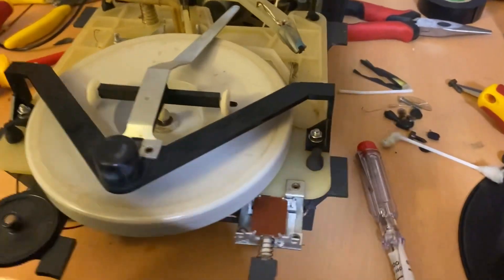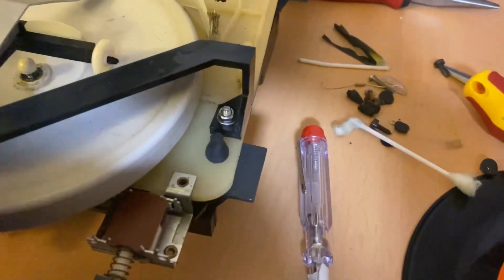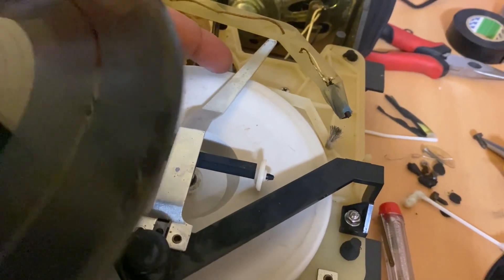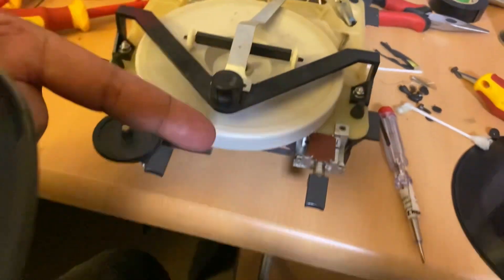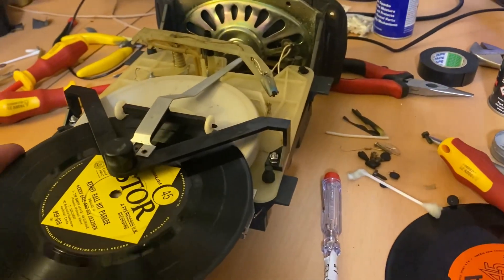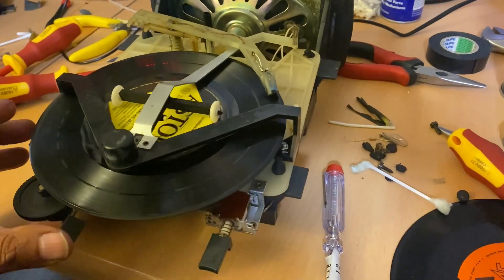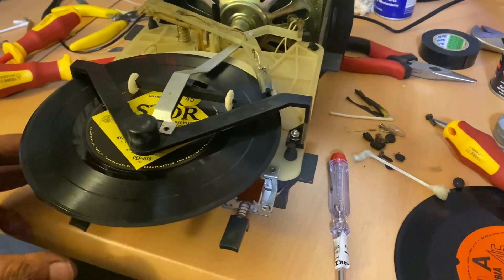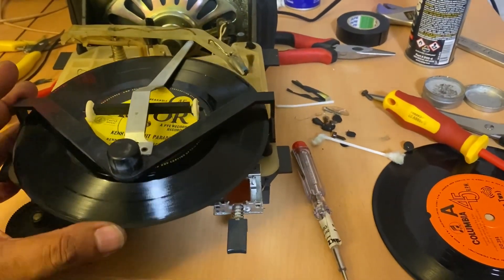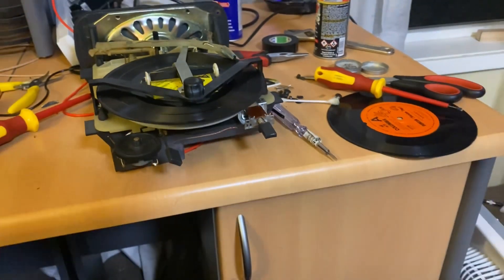The way it throws it out is quite fascinating. The little plunger in the middle of the turntable goes away, so there's nothing holding the record. Then this lever, which is used to engage and disengage the whole mechanism, pushes the record forward and takes the arm back as well. It's simple but quite ingenious. It seems to play even though it's not exactly in the hole, which is quite amusing - but it is supposed to go in the hole.